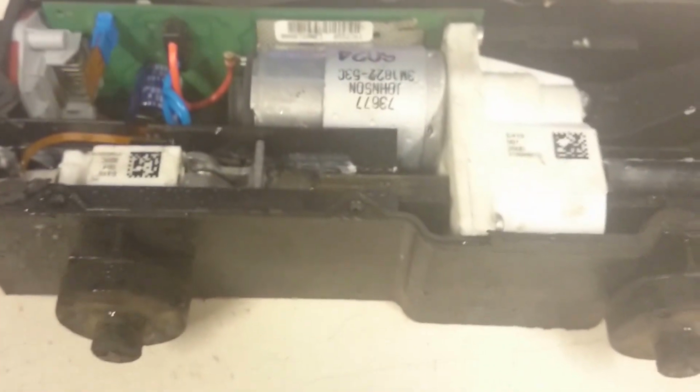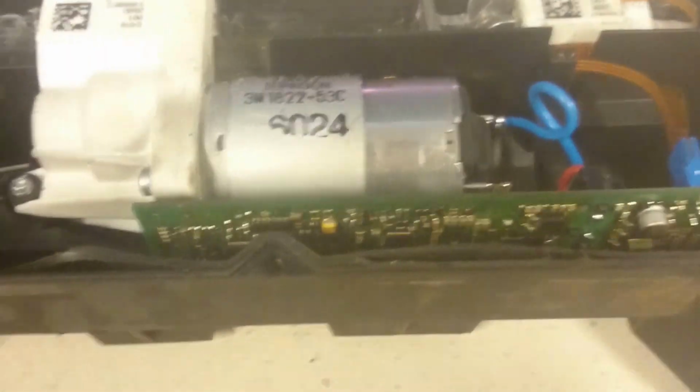Today on the table we have this. This is an electronic handbrake module from a Land Rover Discovery, which I obtained. So what this thing does is, as you can see, it has these two cables coming out of either side. And by some mechanism, which we're going to explore in a moment, this servo motor pulls them in from both directions. So the electronic connector is here.